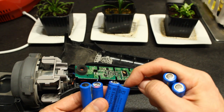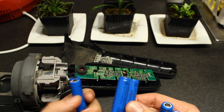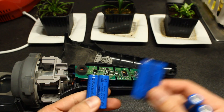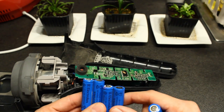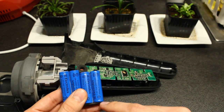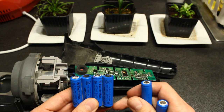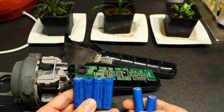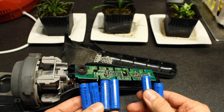What should be done is to put connectors at each of the cell joints. For a 10-cell battery that would be the positive, the negative, and nine additional wires going to the circuitry. Each one of these wires would monitor the voltage at each individual cell to make sure you don't overcharge any of them. Because the circuit is very poor, I don't want to spend money on new batteries that will die again in a short time.